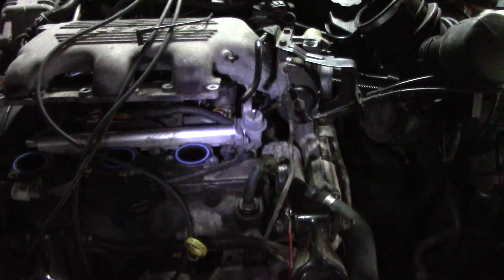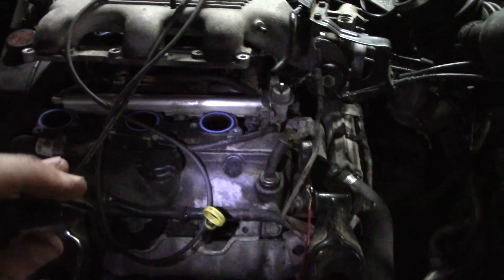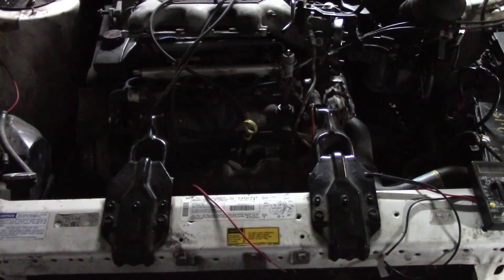I've done that about four or five times now, so there's probably a pretty good amount of gas sitting in that cylinder. I'm going to let it sit before I try turning this car back on. But that does confirm that these injectors are all working. If one of them was stuck on, you couldn't get it to turn off — you'd hear it just spraying fuel as soon as the key turns on. So I'm pretty sure this car does have a bad head gasket leak and there is antifreeze going into this front cylinder causing the misfire. We'll get back in another video and figure out what we're going to do with this car.